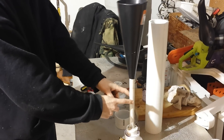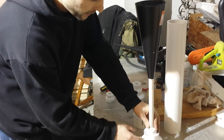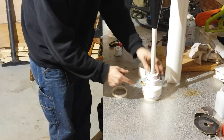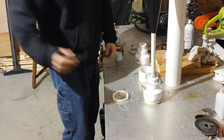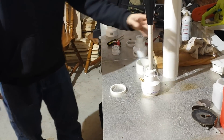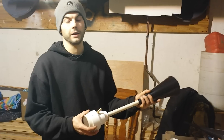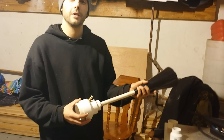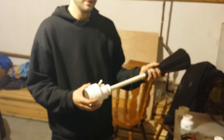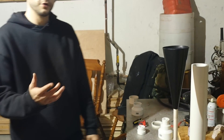The only other thing I can think about is if you build a manifold for these — build a manifold out of half-inch, or go up to three-quarter inch, two end caps, same idea. One air inlet, three outlets going out to your trumpets. You can do five of these. I actually want to do a five-horn setup — I want to do the Nathan train horn. I know they have five different ones — K-L-H something, I can't remember right at the top of my head. I want to do that Nathan train horn, the big one.